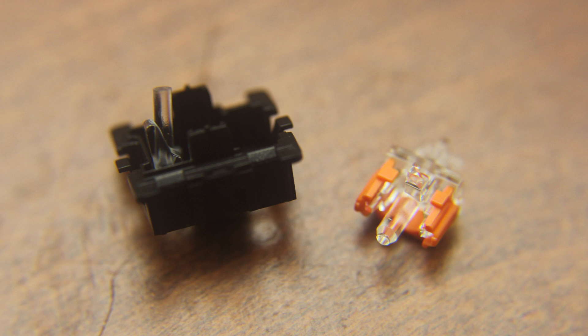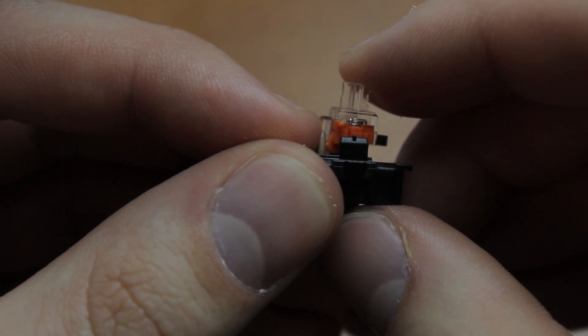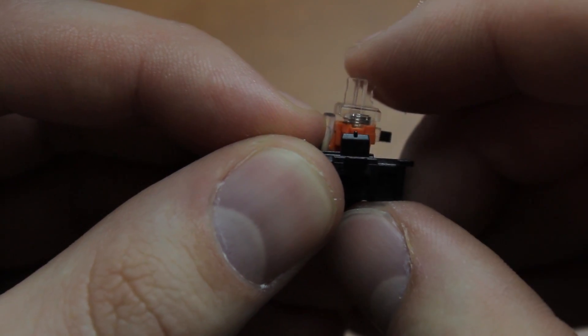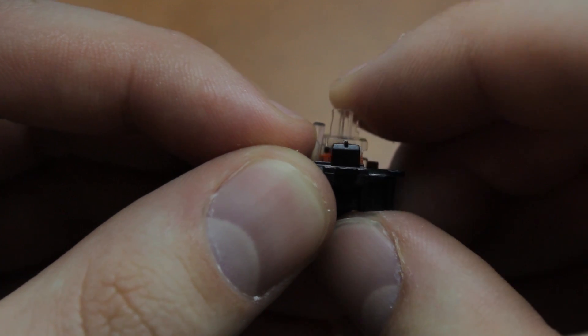The clicker in the clicky switches is based on the MX design — essentially it's a click jacket modified in shape to not get in the way of the optics. But because on clicky MX switches the clicker is dependent on the contacts for operation, and this is a contactless switch, they've installed a dummy contact in the switch to provide resistance. The dummy contact is technically called a click leaf, but this is a misnomer, because unlike a real click leaf such as the one used by Alps for example, it doesn't make a sound itself — it just provides something for the click jacket to hold onto before it shoots down.